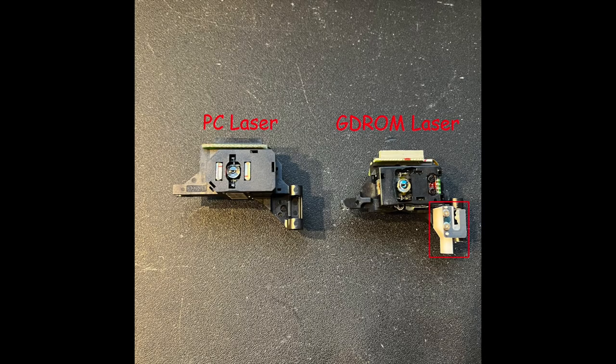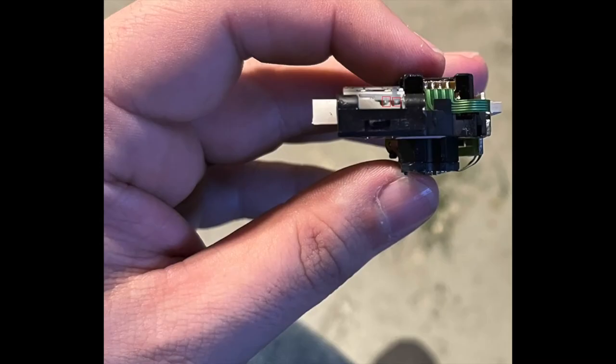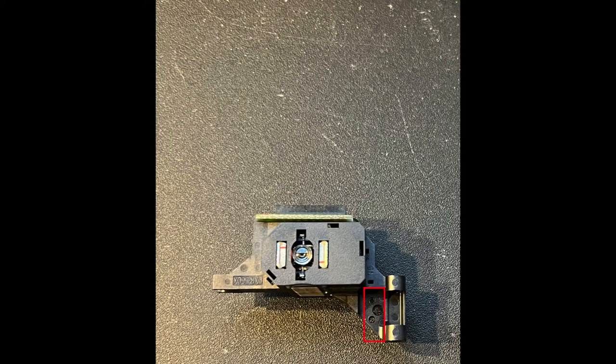Here's a quick comparison of your original GD-ROM laser and the PC laser pulled out of the CD-ROM drive. On the GD-ROM laser, there's a little white plastic piece held in place with two screws — this is a guide. That swirled little rail we pulled out of the GD-ROM drive has two little teeth on this plastic piece that ride the rail, guiding the laser up and down as it moves. It's really important to pay attention to those teeth. If your replacement laser is a little too thick where you mount this white plastic piece, the teeth won't make proper contact with the rail and your laser will not move up and down as it should. If the mounting slot is a little thicker, you may need to use a Dremel or rotary tool to wear down that area so the laser fits properly and the white piece makes proper contact with the rail.